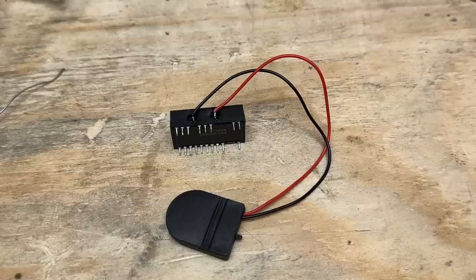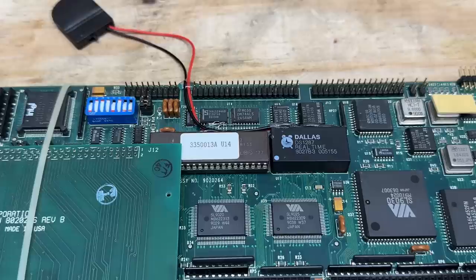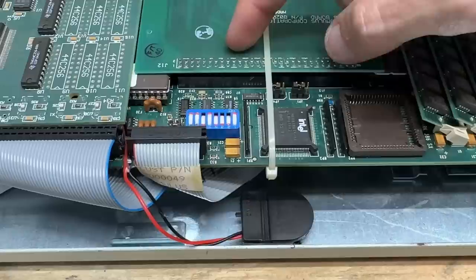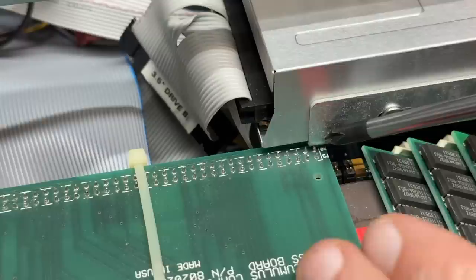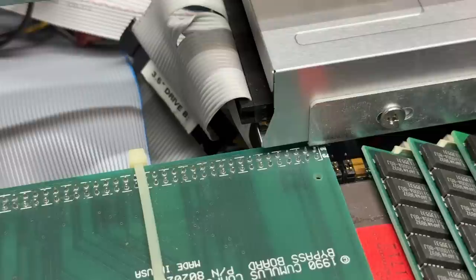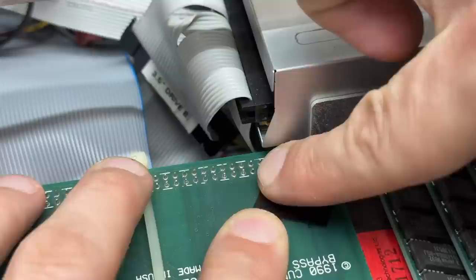The RTC needs a pretty low profile, so I went with an external CR2032 battery pack. So now all that's left to do is seal it up with some hot glue. Got that soldered back on, added a few strategic dabs of hot glue, and I've just velcroed the battery to the bottom of the case - would have put it on top of the card but it definitely would have interfered with any future ISA cards. I just noticed how perilously close this connector is to shorting out on this floppy drive bracket - not even a millimeter. Sure hope that's a ground pin. This floppy drive bracket's riveted in place so I can't even move it - let's just go ahead and get a lot of electrical tape in there. Folded it up six or seven times, just in case.